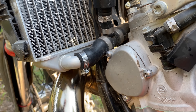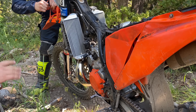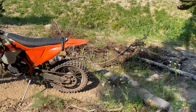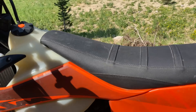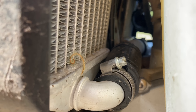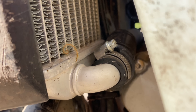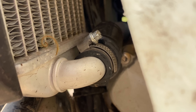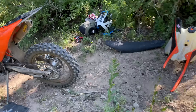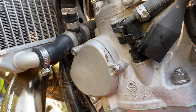Sometimes it smashes the elbow, but luckily that didn't happen. I noticed I had coolant coming out and Tyler has seen this — he's done it twice on his bike. He's got some things here that I need. Might be kind of hard to see, but right back in there he's got some extra guards. These are like a plastic rubber. Tyler, what are they? This is a type of plastic that just gives some extra protection between the hose and this power valve cover.